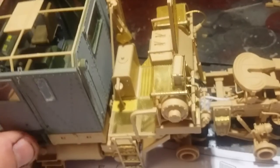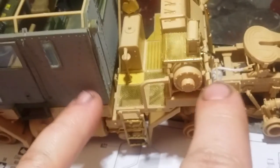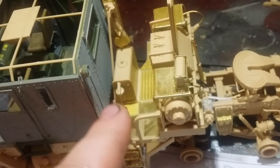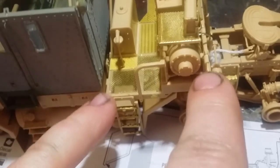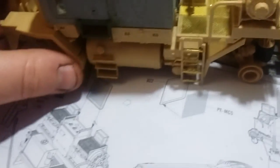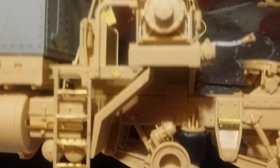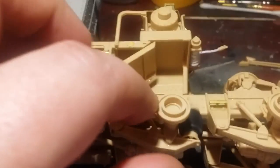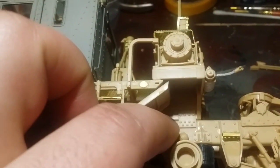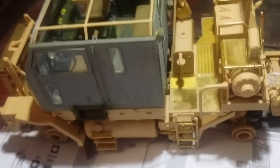When you're sticking that on to the actual rig itself, once it's on and you finish the assembly as this is now, you have got some adjustments to make. Because you've got to wait for the back of the cab to be on to give you a distance, but you can move this whole unit a couple of centimetres backwards or forwards, so it is a little bit adjustable. On the underside you can see that panel just in here with all the nuts on — that hits this part here. So you've only got a limited amount of movement with it, and with that you've also got to be cautious of your tire clearance as well. Move it too far back and your tire won't fit.